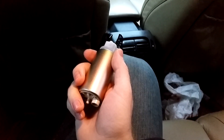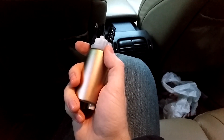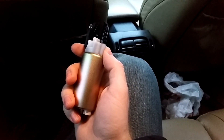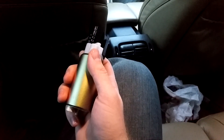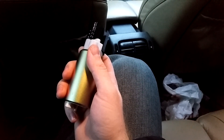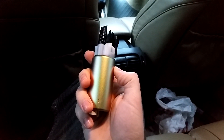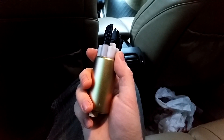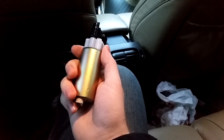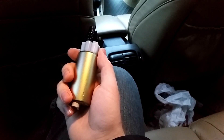Let me sum up this DIY video for changing the fuel pump. I'm sorry I wasn't able to film all the steps — ideally I want to show every step, but it was pitch black outside and I had a time crunch needing to get the car running. I think a video like this is still better than no video at all. This has been an overview of the procedure for changing the fuel pump in the Saab 95, model years 1998 to 2010, with the exception of the biopower cars. If you have an E85 biopower car, the procedure will be more difficult because you'll need to drop the tank — the biopower pump won't fit into that hole from above.